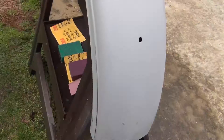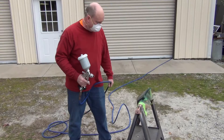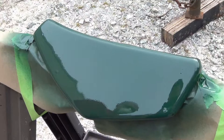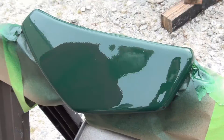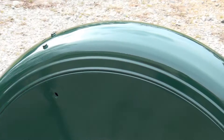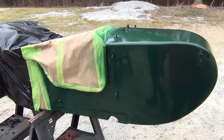We've been out here painting — not the most expensive gun in the world, certainly not the most expensive paint, and probably the most inexperienced painter as far as painting cars go. I don't think it looks too bad. Got a little bit of orange peel; I cut the air back and went with more coats to build the color up and the orange peel seems to be better. We're outside so we're going to get little bits of debris or dirt from somewhere. The last car I did looks pretty good — it's got a bit of a texture to it but that's okay.